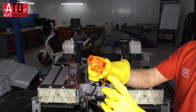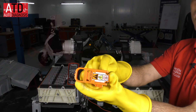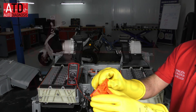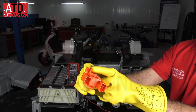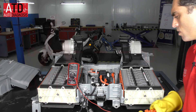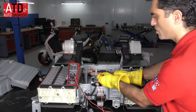As you can see, we have here two big pins for the high voltage system for current. In the back we have a fuse — the main fuse — around 125 amps. And here you have the interlock pins for the interlock circuit. This interlock circuit is used to detect whether the connector is applied or not. When this service plug is disconnected, we will have zero volts — so it's safe.